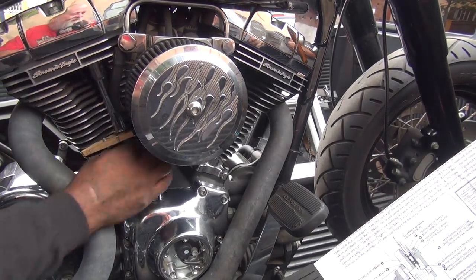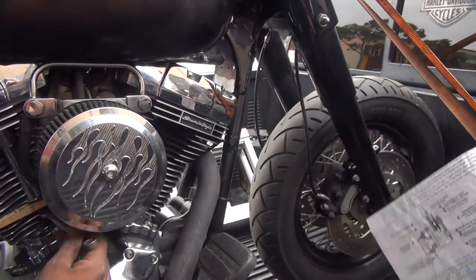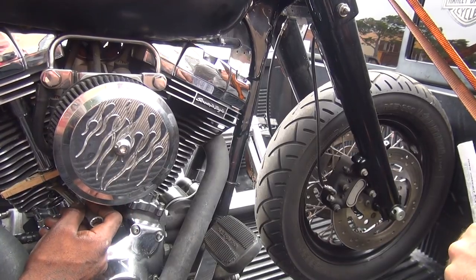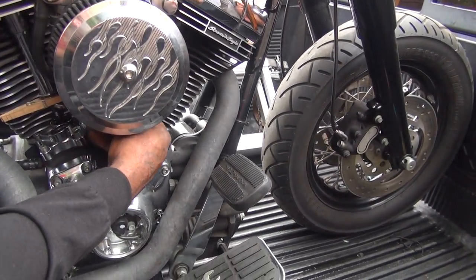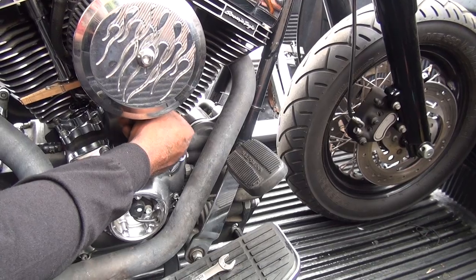15 flats — that's where I'm at, right? Look, zero. Right there. Can you read? 15 flats. How many threads per inch? 24. There you go. I'm doing three things at once around here. So each flat is one of these — but you go from the bottom usually. You hold the top and then you put another wrench on the bottom and you go 15 flats.